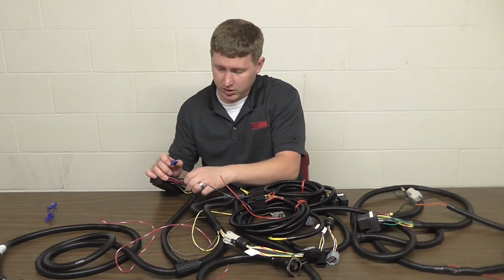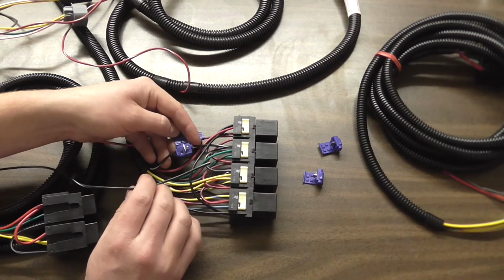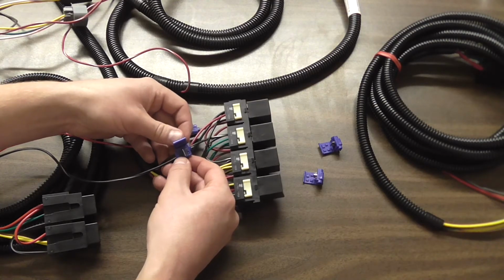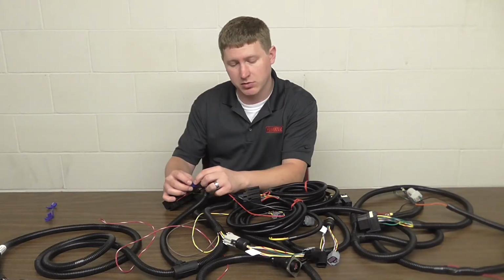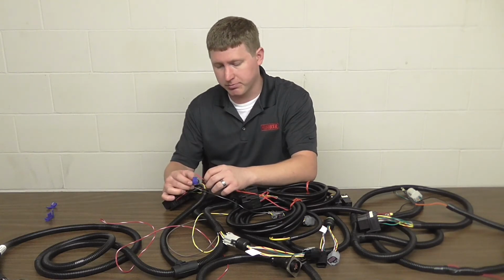So we take the appropriate wire, in this case the black wire with the white stripe, mount the Scotch lock onto that wire, place the wire that we're tapping in with, and then using a plier, clamp down in the Scotch lock in order to tie that into the circuit. Repeat that for the red wire with the black stripe and we'll be up and running.